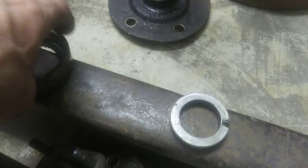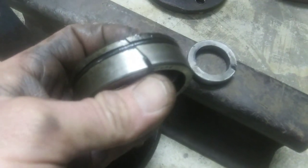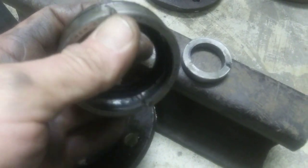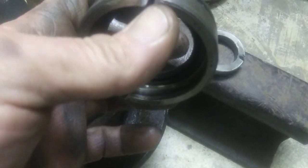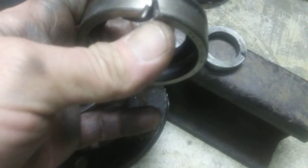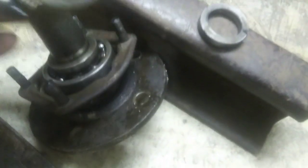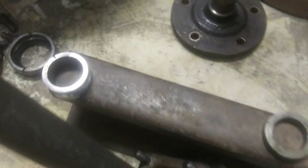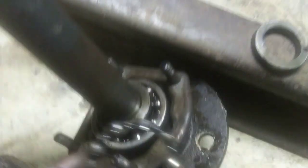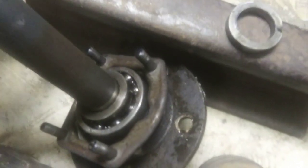There's the axle. And then on the outer part of the main bearing, I only cut it about a 1/4 inch, popped it with the cold chisel, and then went around the other side and cut it, not even a 1/4 inch, maybe 3/16, maybe almost a 1/4, and then popped it with a chisel, and it opened up like a clam, and I was able to lift it off. So that part's junk. Then I was able to pull the bearing cage out of there, which released the bearing cup. And then this is the main bearing roller.